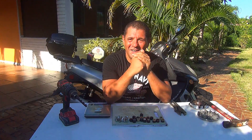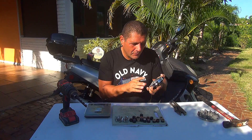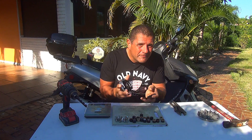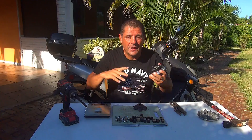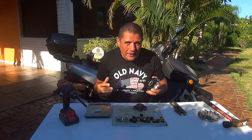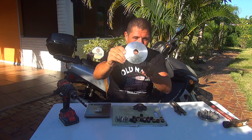If you don't want to buy new roller weights or you want to modify the ones you already have, there is an easy solution. First, you have to remove your roller weights from your scooter. They are located on the lower left side, behind the CVT cover — that's the transmission. In the front part you'll find the variator.